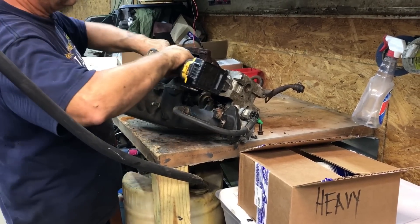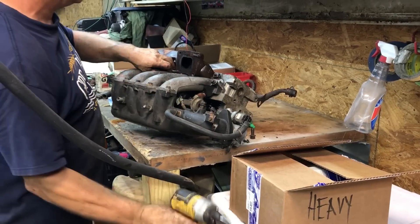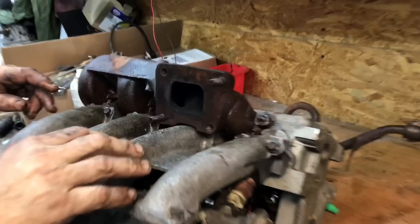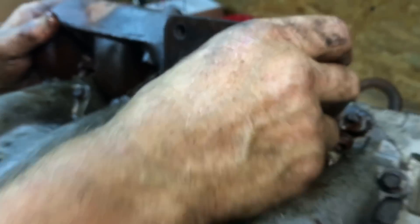Fancy exhaust manifold? I'll probably want to use this one. That's a T2, isn't it? Yeah, it has that notch - see? That's for the one piece intake manifold. Both the long runner intakes have this notch right here. For the one piece or the two piece? The earlier stuff didn't have it.